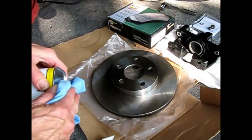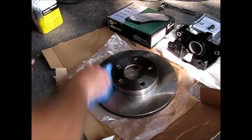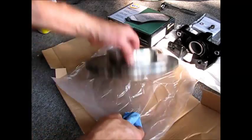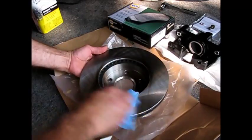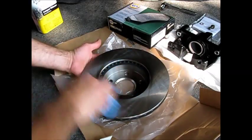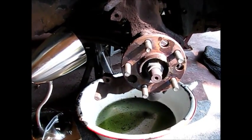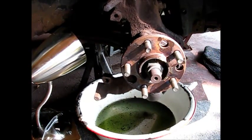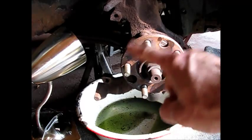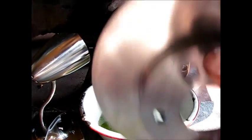You have your new rotor ready. It's a good idea to just go over it with lacquer thinner and a clean rag — you don't know if it's been coated with something. I always assume maybe there's a little bit of oil or some kind of protective coating for shipping, and remove that. Before you put it on, it's not a bad idea to go over the contact surface. Brush it off with a wire brush, because rotors can rust right to the hub. Put a little bit of grease on there around the surfaces, so hopefully next time it comes off without any trouble.